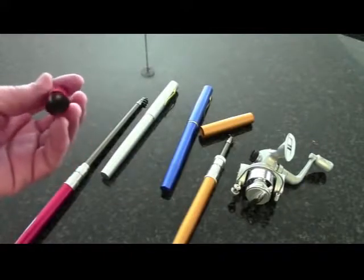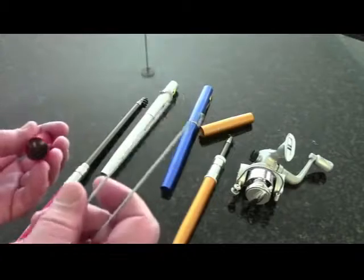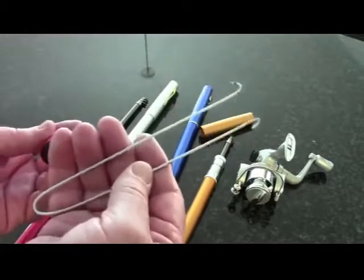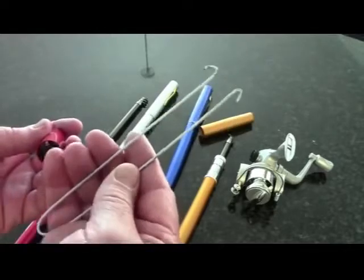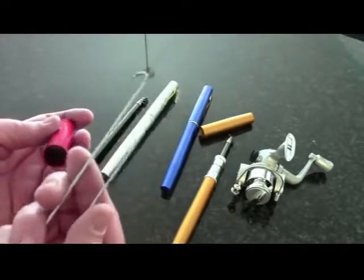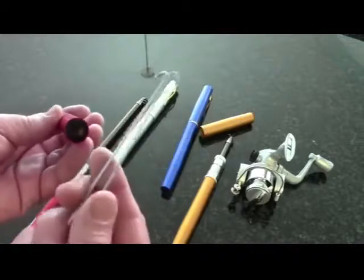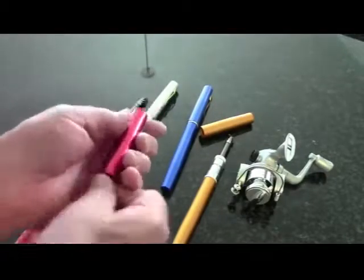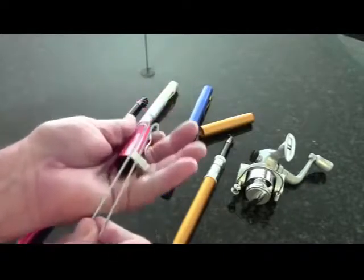And it's a very high-tech, sophisticated tool made from a clothes hanger. You can do this with cutting pliers and needle nose pliers pretty quick. You can make it like this, and you see the intent of it. We want to get that nut. You're going to close these together, and it'll hook the nut and get it out. Let's see how we can do it. It works almost every time.